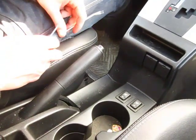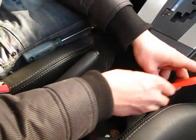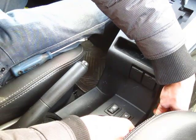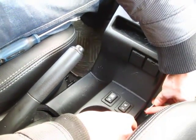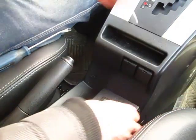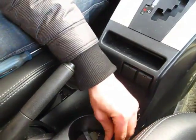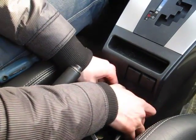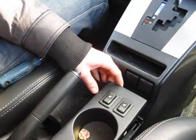The cup holders are just held on clips. You need to pry them up with a hook because you can't fit a clip removal tool there. You can even use your hands — that will ensure you don't scratch the panel. And it just comes up.